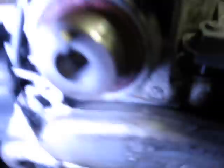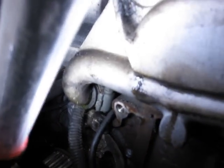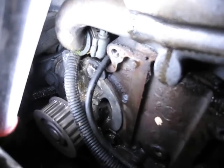The housing that goes from the thermostat housing across behind the timing cover — it goes across here and then it inserts into the side of the engine block. I don't know if you can see, there's a little green tint where that goes in; it makes a right-hand turn into the block. That's actually where we were leaking. That's the water pump down below.